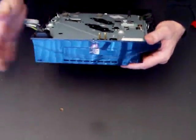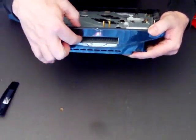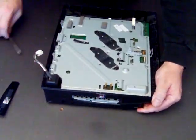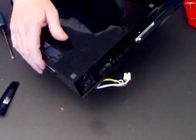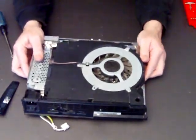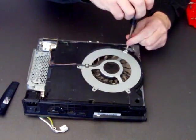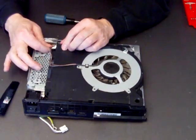The next thing to do is on the side here — open the cover and remove the hard drive. I've already removed this one for speed. There's a little blue screw in it, unscrew the screw, it slides back and out it comes. That's all the screws removed. All to do now is turn it upside down, give it a bit of a shake, and off it comes. Underneath you'll find the fan — you'll need to remove the fan, it's just three screws. These are universal, so all fans fit all PlayStations.